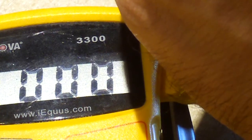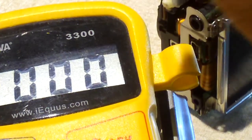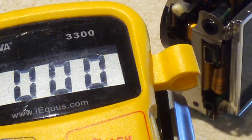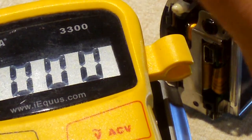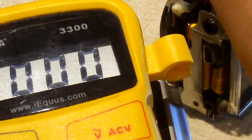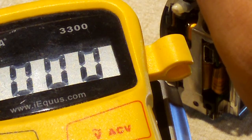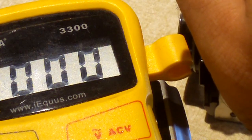The flash on the camera was last used about 2 days ago. However, it is not uncommon for cameras to top off the flash cap regularly, even though the flash is not being used. This is why this is so dangerous. This can be dangerous.